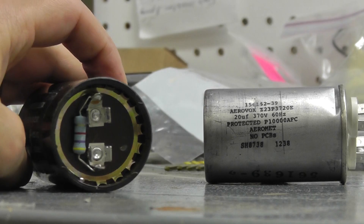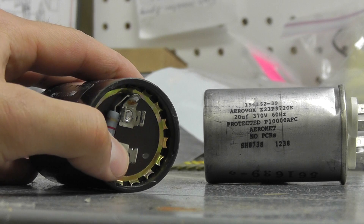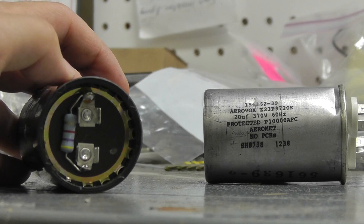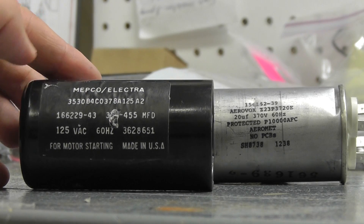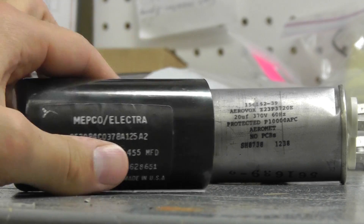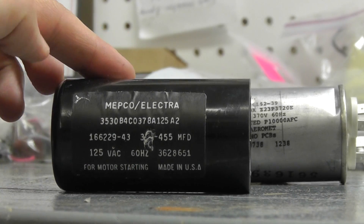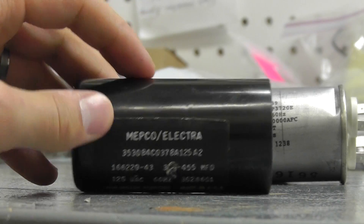You have your contacts over here. Typically you'll have one wire going to each terminal — one here, one here for wiring. When you unhook the terminals from your old capacitor, just hook them in the same exact locations if you can. Usually two wires go to each capacitor. Also, the most important thing is probably dimensions. This right here measures right about three inches and change, and of course the diameter.